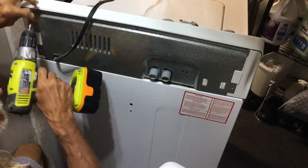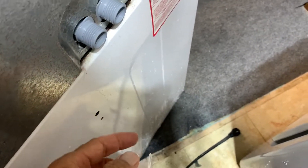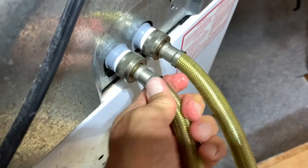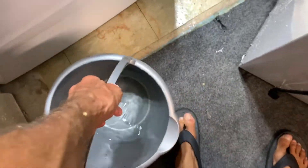Now I'm going to put all three screws back in and tighten it down — I'll do that in fast motion. Then I'm getting a little bit of plumber's tape and wrapping it on the water line threads. Next I reattached the cold and hot water lines to the back and used the channel locks to make sure they're tight but not too tight. Looks good. Now I've got to clean up the water under there — keep the pail nearby just in case everything goes south.